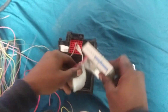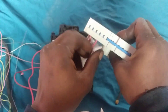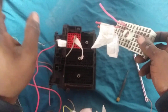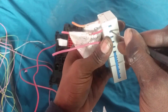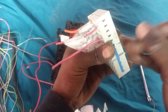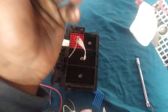To depin these plugs - a lot of these wires you're not going to need. Literally a lot of these wires go to other things like the transmission. If you're doing the factory standalone harness, you're not going to need a lot of those connected wires, so you can go ahead and delete all of those. Just know what you're deleting.